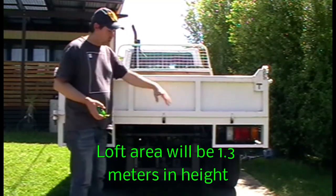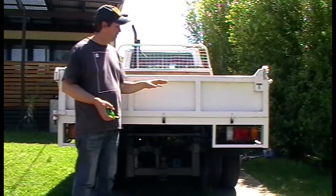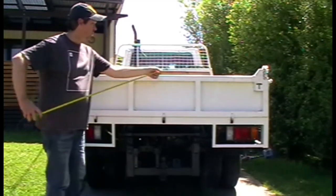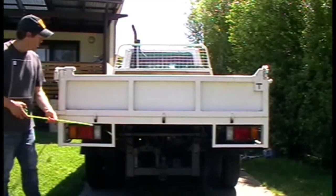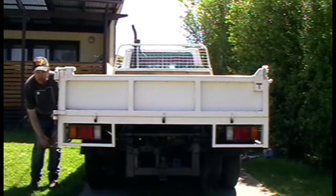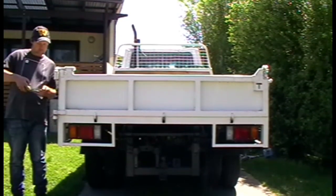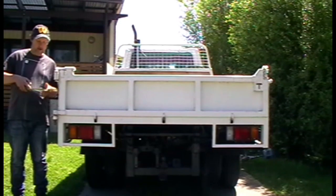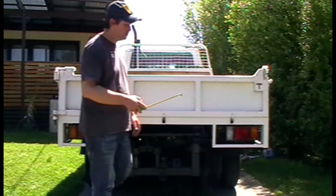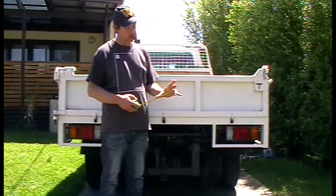So that's the way to get the width of the tires, which gets you your height maximum. And for a truck like this, the width I can go is actually wider than the tray on here. So my width for a legal tray is to the wheels again. We've got the wheel measurement and it's 300 beyond the wheels. So I could come out to about here. I'm not actually going to. So 300, or even if I allowed 150 mils each side, that's still like that.